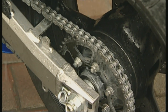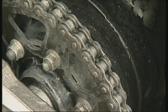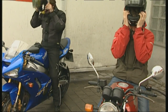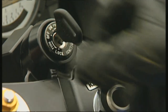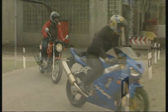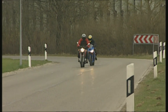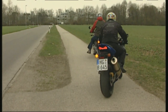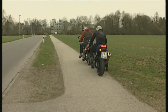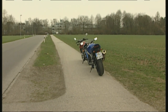Now we just have to do a test drive. Many products will part company with the rotating chain after just a few kilometers. Reduced lubrication will increase the friction between the joints. To maintain the lubrication of the O and X rings, you need a chain spray that stays where it should — on the chain. A good access point is on the underside of the tail. Both tests returned excellent results. No chain lubricant had come off with centrifugal force. The adhesive grip of the S100 chain spray is outstanding.